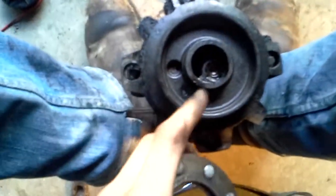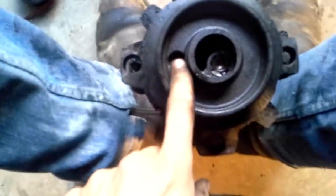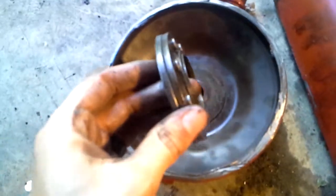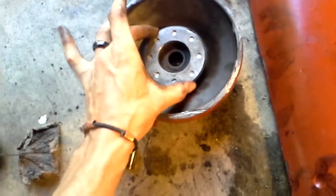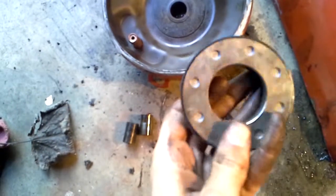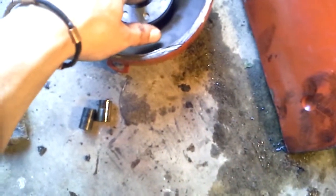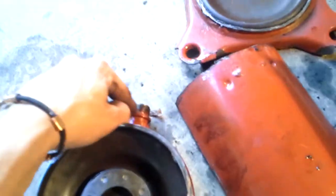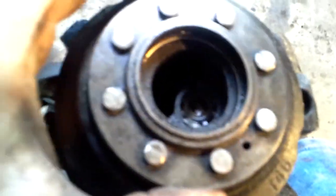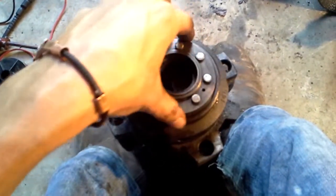This is the high-side seal. In that little divot there's a pinhole — gas comes up through and pushes against this seal. The lip seats against it, so the higher the pressure builds, the tighter the seal. There are two seals — one here and one on the inside between those two steel plates. As pressure builds it pushes against that. The compressor puts high-pressure gas through and discharges it out. This sits in limbo until the compressor revs up, builds pressure, lifts to seat, and the seals on the side keep it sealed.